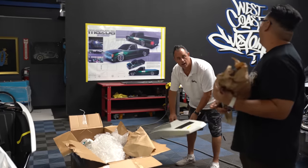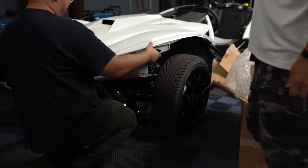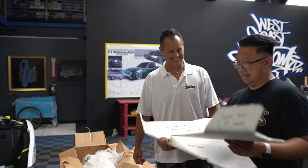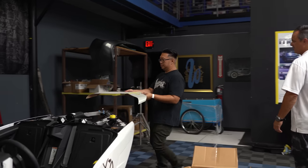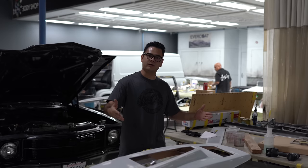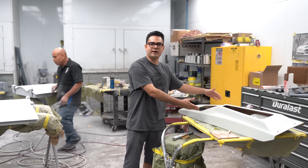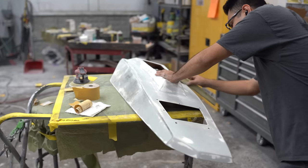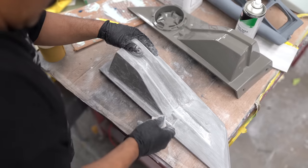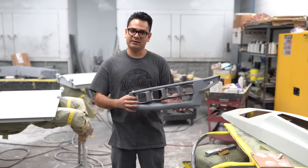Oh, the headlights! Those are the Bugatti headlights. Oh bro, that's going to look so dope. There's one way to make directions — just write the directions on the actual part. Hey guys, it's Ian from West Coast Customs, and I'm here with this custom-made hardtop system for a Polaris Slingshot. It's now in the body shop. This one's already been done, prepped, and now it's ready to go back over so they can wrap it. We have this other part of the hardtop — as you can see, it hasn't been prepped. We're currently in the stage where we're still putting Bondo fillers, working it all out, making sure the lines are straight, sanding it down, making it smooth. Over here we have this custom headlight bezel that also has to be prepped. It's got a really nice, aggressive styling — it kind of resembles a Bugatti. Once this goes on the body, it's going to look really, really nice and aggressive.